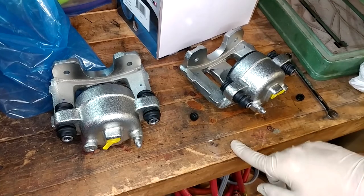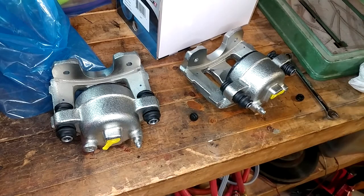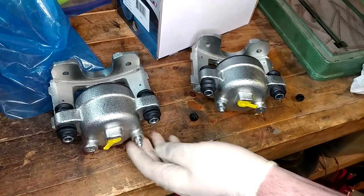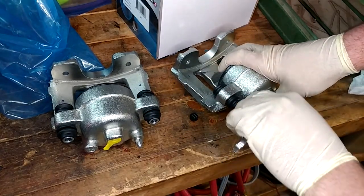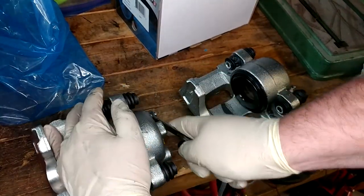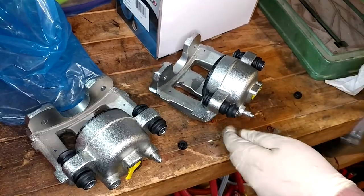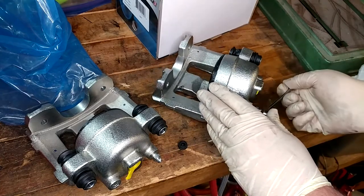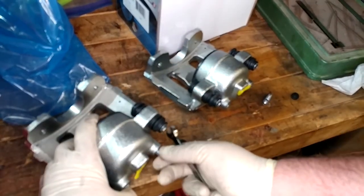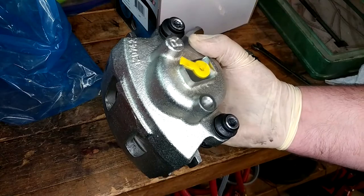I got them all greased up. Due to issues I've had with Power Stop calipers - you can check that out in the Escort front brake video linked up there and in the description - I decided to check out the bleeders and these look good. Since I'm here, I'm just going to anti-seize them now so I don't have to worry about it later. I like to anti-seize my bleeders so they don't seize. This is also a good opportunity to inspect - if a bunch of metal comes pouring out, we know we're going to have a big problem.